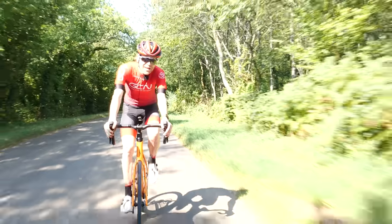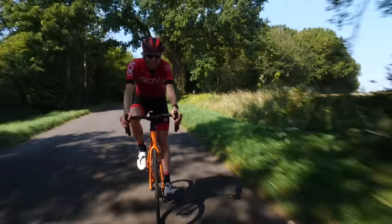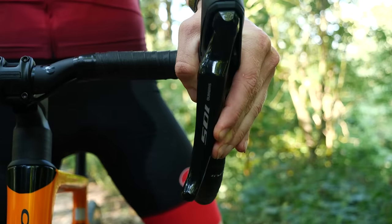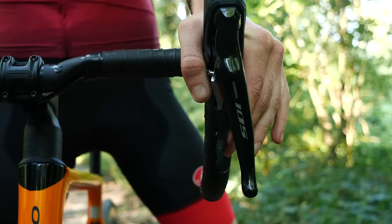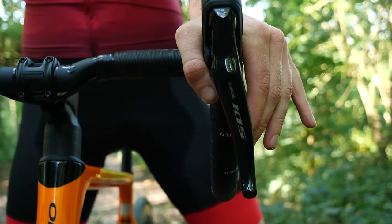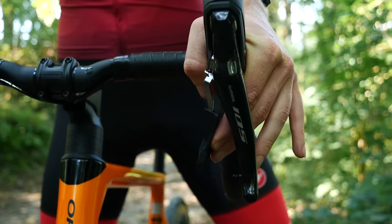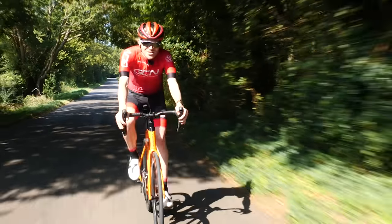But a cool area where there has been improvement and refinement is in the lever action of the shifters when you go to change gear. By tweaking the mechanical action, and also improvements to the design of the derailleurs and how they manage the cables, the lever action is much lighter, and the lever throw, the distance you move the mechanical lever, is slightly shorter as well. It's really cool.